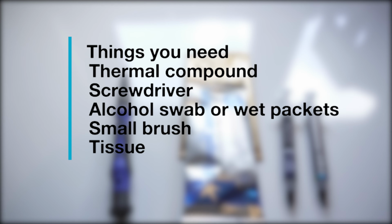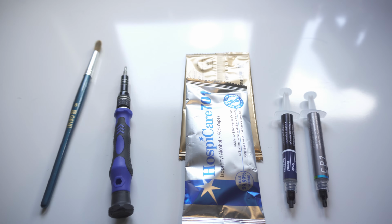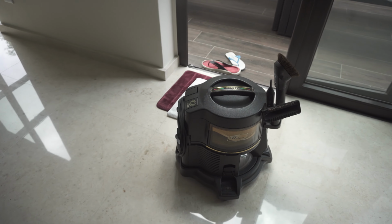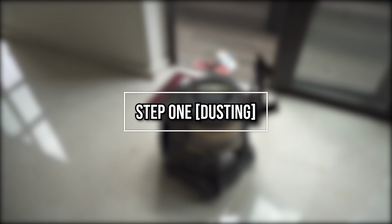Now for the tools you'll need to do this procedure. You'll need a screwdriver, thermal compound, of course. Make sure you have good ones, either Cryorig CP7 or some Noctua thermal compound. Thermal Grizzly is also good. I'll link these in the description down below. Wet wipes, preferably alcohol wipes. A small brush, an air compressor or canister. The canister, I will link it in the description down below. If you have a vacuum that has a reverse function and is strong enough, divert all the air through a small tube, then you may use that.